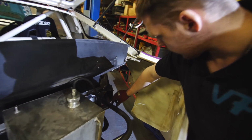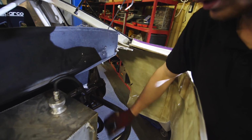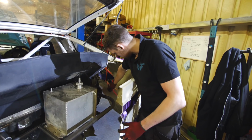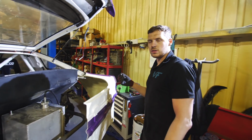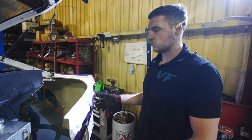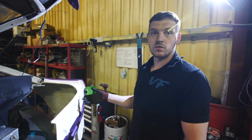So there'll be a bar coming from here and it'll be all unboltable. So this whole piece is unboltable. These will be individually unboltable as well, so they'll go out to the clamshell. They're made of a thinner metal, so the idea is if it hits the wall, they'll just bend, or even the bolts will just break and they'll fall off or whatever.